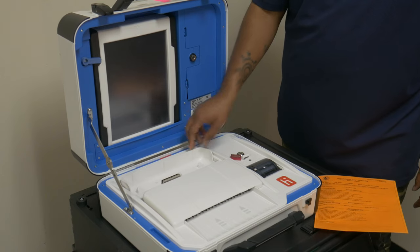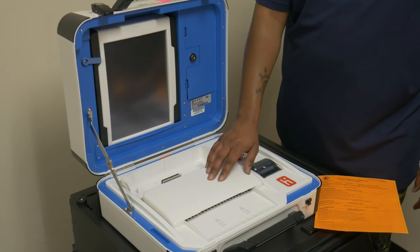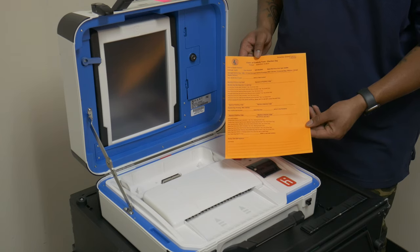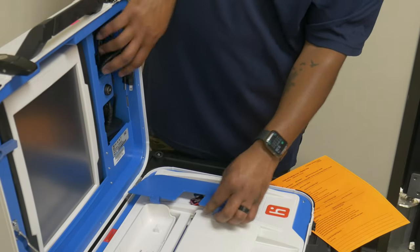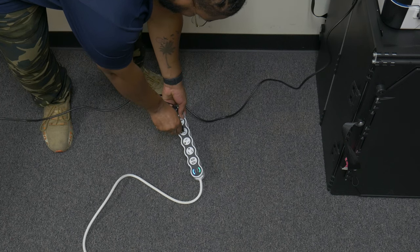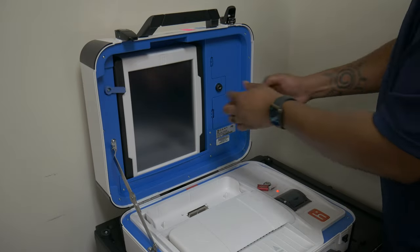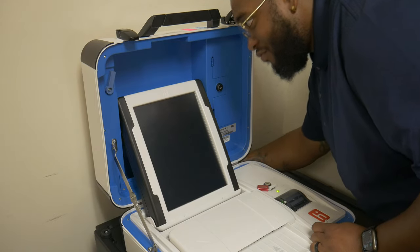Located to the left is the tablet dock. Below the V-drive compartment is the report printer, and to the left of the printer is the ballot reader — the slot is where printed ballots are inserted to be recorded. The piece of paper inside a sealed scan when first opened is known as a chain of custody, indicating the scan hasn't been tampered with during transit. Remove the two halves of the power cable, connect both halves, plug the three-pronged end into a nearby outlet, and plug the locking end into the port to the left of the red power button with the flat side facing up. Open the lid, remove the tablet, place it into its dock, and turn it on.